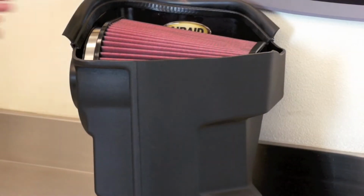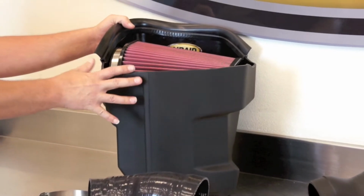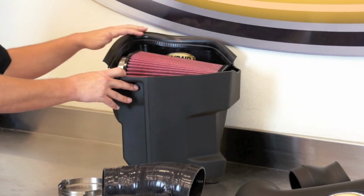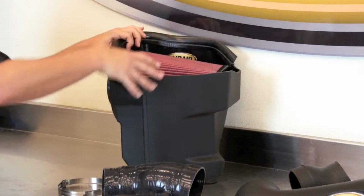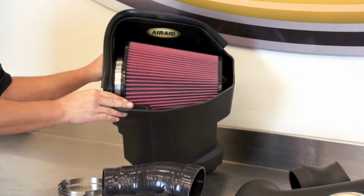The MXP systems for all three engines start with a complete replacement MXP roto-molded intake box. Now this is a direct replacement for the factory airbox and there are no modifications needed. It has a built-in velocity stack and this weather stripping seals against the underside of the hood. We're using a hood like a lid for the airbox itself. Of course we include more forward-facing cold air inlet ducts as well as one underneath. But this allows us to oversize the filter itself, and that is where you get the increase in flow.